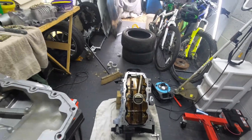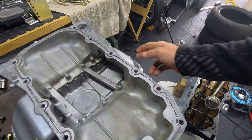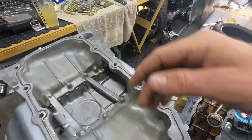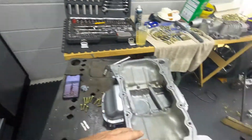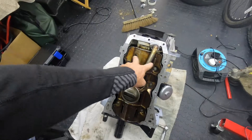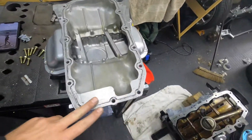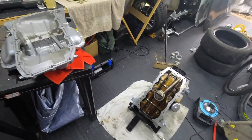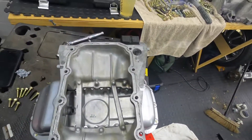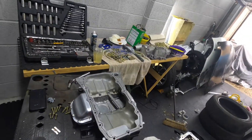It went pretty well to be honest but I'm a little bit annoyed about that. At least I'm going to put the main panel on knowing full well that at some point I'll have to take that off and re-torque it back down. But these things happen - I should have perhaps done a bit more research or remembered I had taken it off, but as it's my first time doing it I'm not too annoyed. Now counting up the bolts, making sure I've got all the right ones to hold this onto the bottom of the engine. I've torqued these all up to spec, I'll check the torque settings for this one, fill it up with RTV again and then put that one on the engine.